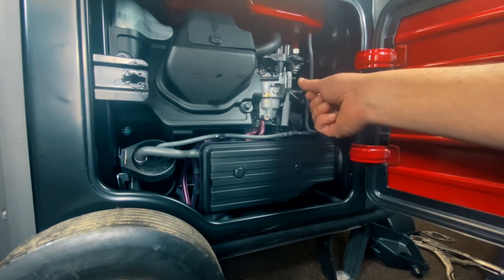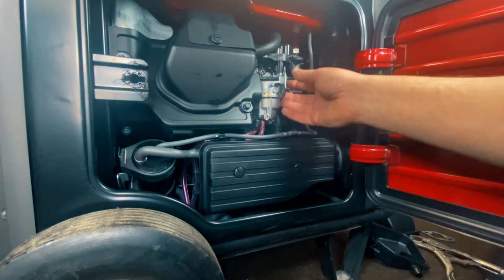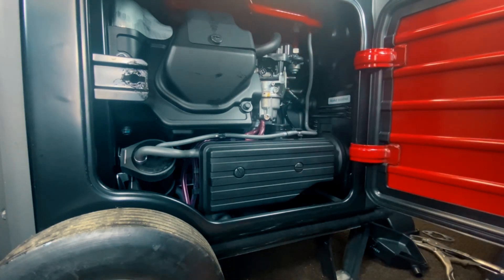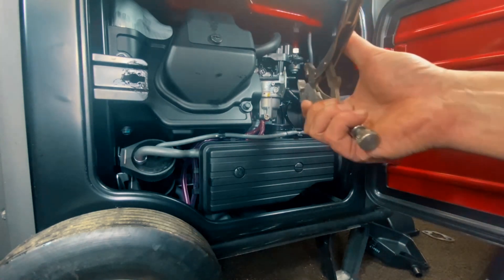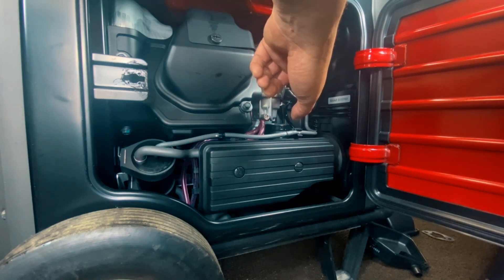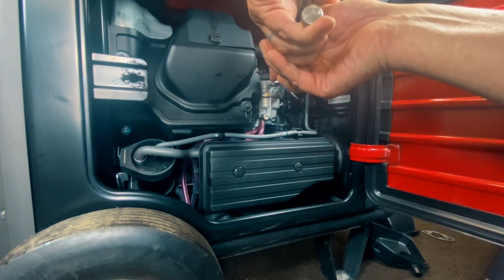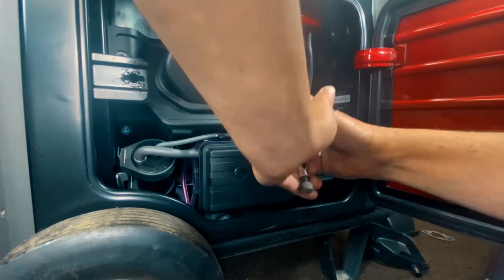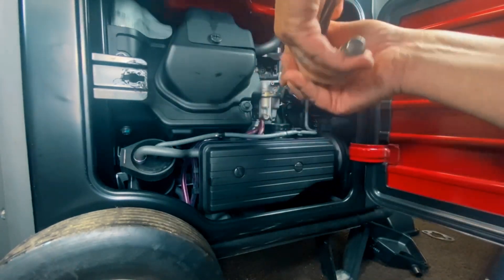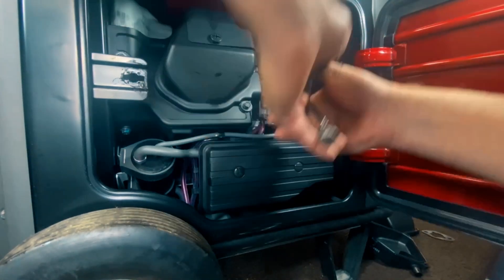Obviously it brings it out a little bit, so when you put the air cleaner cover back on there's not enough meat to put the nut back on. There's a metal plate on here — you're going to remove this, you will not reuse it. We're going to supply you a gasket for that. Get your vise grips and don't go to the ends, or you'll never be able to get the nut back on. Go ahead and get down on them and give them a quick pop and they'll turn. I'm going to bring these out about a quarter inch — you'll have to go back and forth just to make sure it all fits and that you can get the air cleaner cover back on.